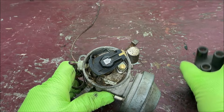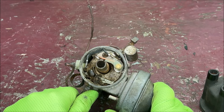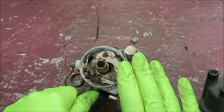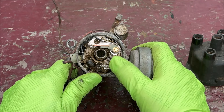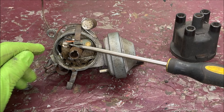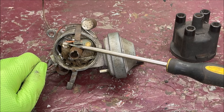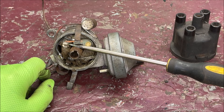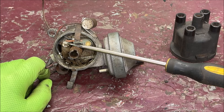Let's pull our rotor — these are things that folks don't do. They put their distributors in and drive along for a couple years and then have issues. First things first: there are your points. A lot of people run Pertronix — I'll go over that at the end. You're going to want to check your points to see if they need replacing. Open the points up, spread them open, and look in there for buildup on the contact part. If there is, take a piece of sandpaper or emery cloth — use a very light grade and sand lightly just to get the buildup off. That way you have a nice, beautiful spark.